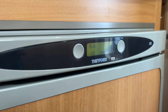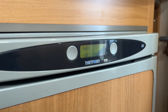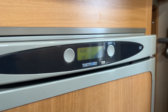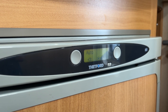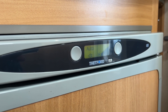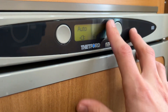When wild camping with the engine off, the fridge does wait 20 minutes before lighting on gas — it's a safety feature in case you forgot to isolate your gas bottles and you pull into a petrol station; you don't want it to spark. In this instance, all you need to do is turn it off auto, turn on manual gas, and it will light straight away, meaning you've overridden the automatic feature.